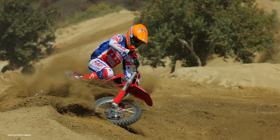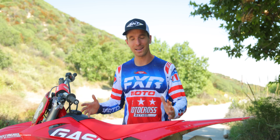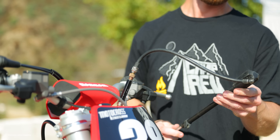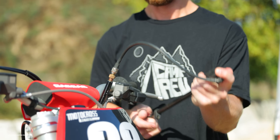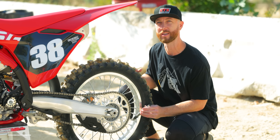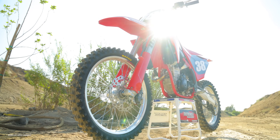I'll touch on my personal experience today. I weigh 175 pounds, so I'm a little bit heavy for the suspension, but I had a blast on this GasGas MC250F. You could probably tell by the video I was feeling comfortable here at Glen Helen Raceway. The suspension is softer — it doesn't have the hold-up that KTM and Husqvarna have. If I was racing today I would choose the KTM suspension, but the track wasn't super rough. I was okay with the softer suspension, running 10.5 bar air in the forks. A reminder for those who don't normally run air forks: set your pressure in the morning and check it throughout the day as the bike heats up, just like tire pressure — 10.5 bar is what's recommended stock on these GasGas forks, and it was a great spot for me today.